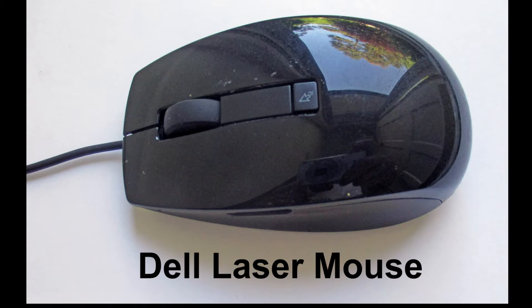If your mouse is erratic, if you move it around and the light goes off and comes back on, the cursor appears and disappears, there's a good chance that it's a broken wire. It usually occurs right where the wire enters the mouse, from flexing.